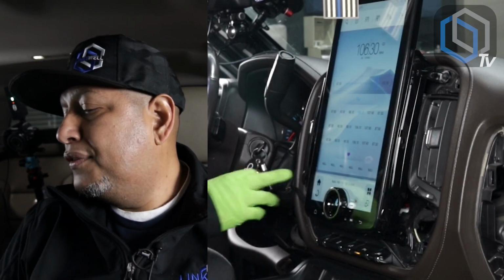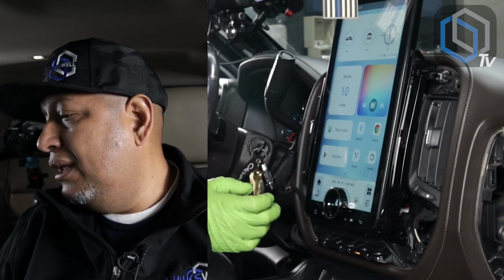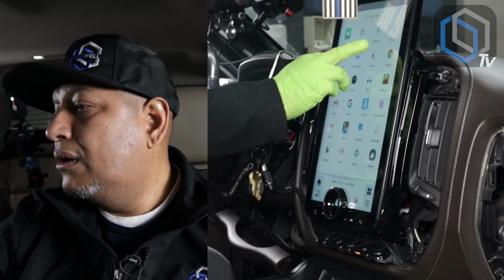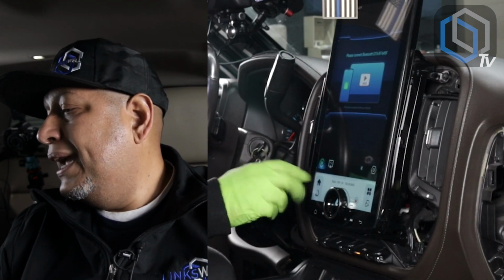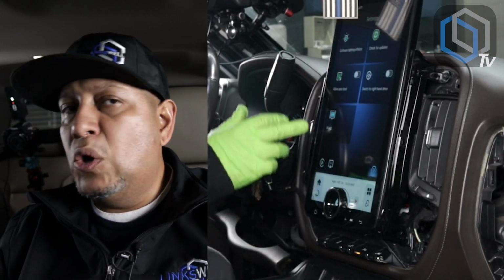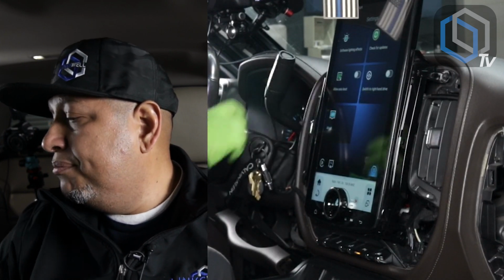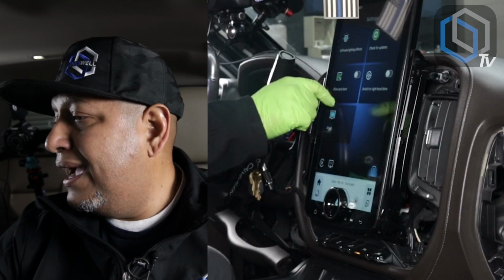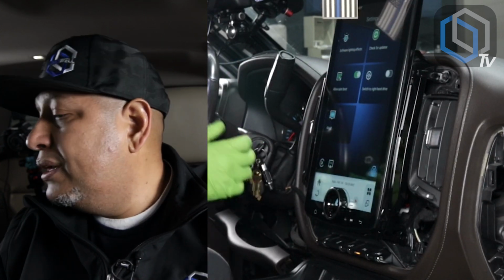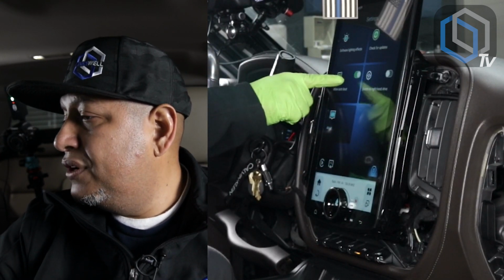All right, so we're back at the home screen. Before I go into Bluetooth to pair my phone to this radio, make sure that you open up the Car Auto application. The Car Auto application has a hexagon button right here on the bottom right. When you touch that, it's gonna open up a list of menu options. One of those options is allow auto boot. What you're telling this app is whenever the car turns on, make sure you launch and connect to my phone. So I'll turn that function on.